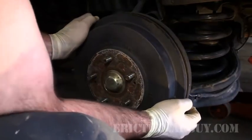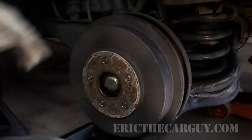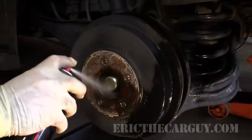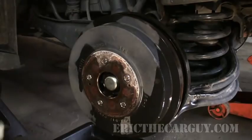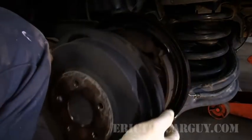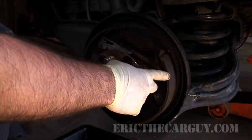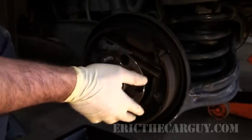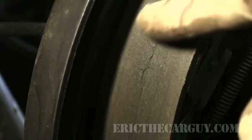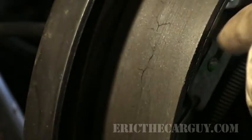I'm going to work the drum off a little bit — it's almost off but not all the way. There's enough space where I can get in behind it, then I'm gonna take my brake cleaner and go in. You can see all the dust coming out — you're going to clean it anyway and this will help cut down on that particulate matter. Brake shoes take a really long time to wear out, sometimes more than a hundred thousand miles. I'm starting to get some noise from these, and I'll show you why — see these heat cracks? I think the parking brake was left on and compromised these shoes.